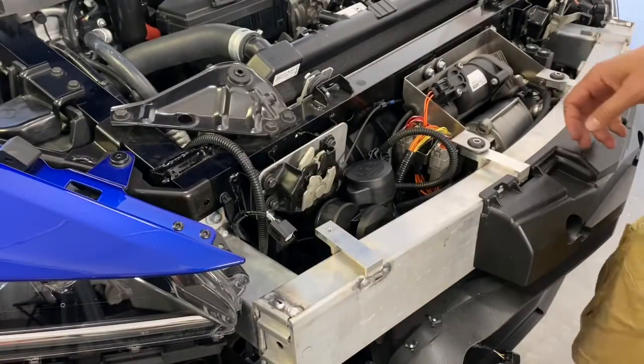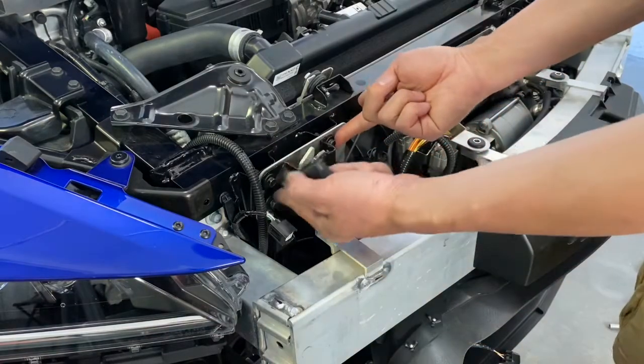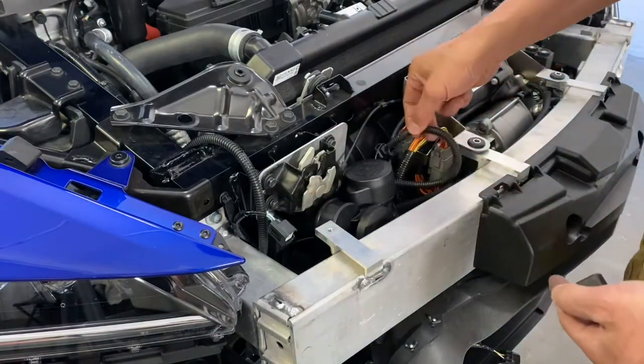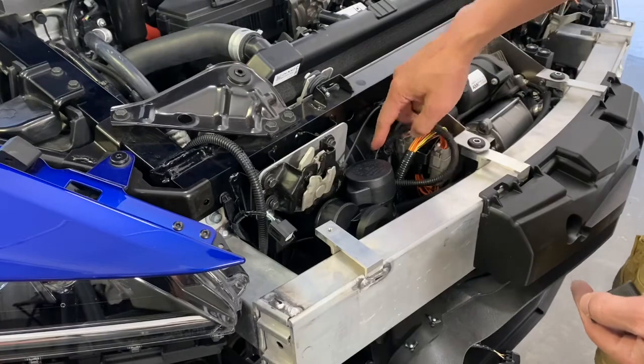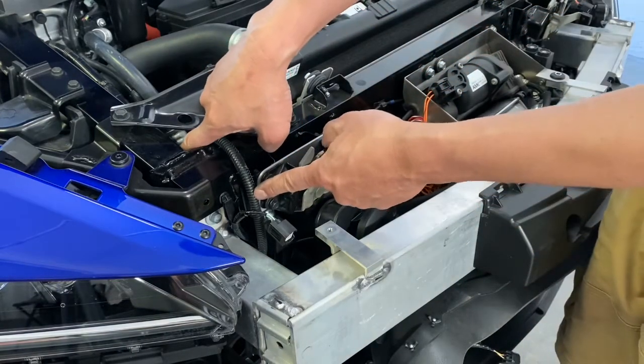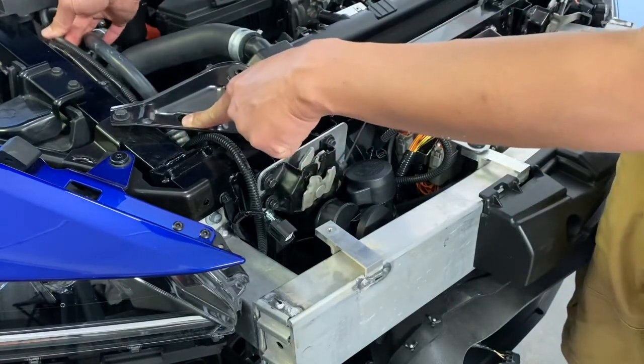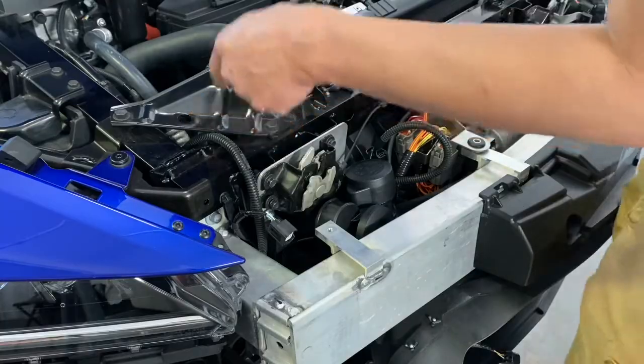Okay, so we got the new horn assembly in. It's all bolted in, 3 10 millimeter bolts hold it in. We ran the cable for the plug to the factory horn. We routed the harness underneath here, to get it out of the way. It's a little bit easier when the bumper's off, of course. So we ran it underneath over here, and then this will be zip tied over here. This thing feeds over to the power side of the battery. We attached the ground in here.